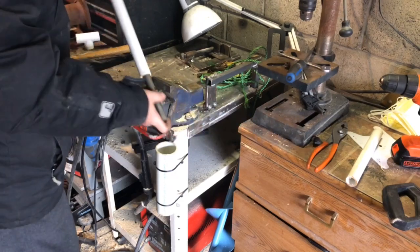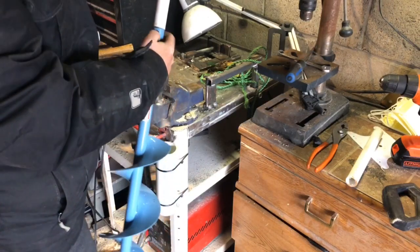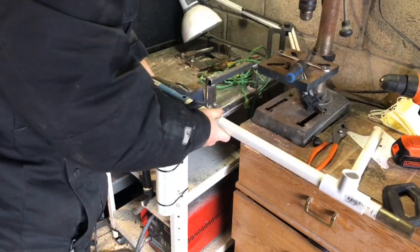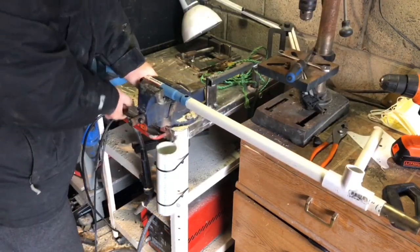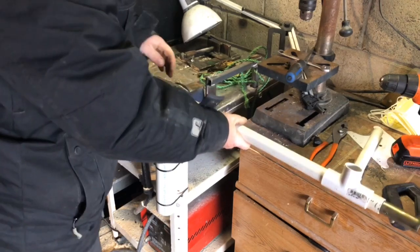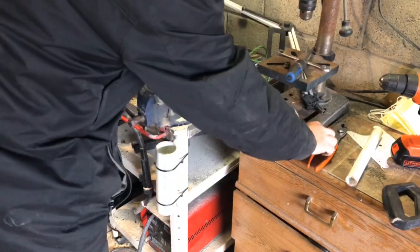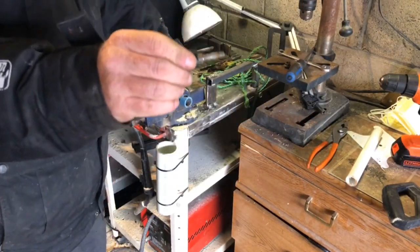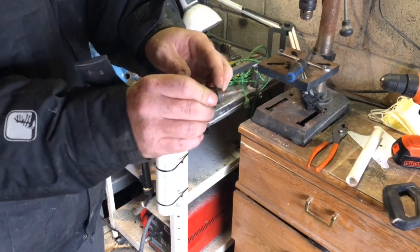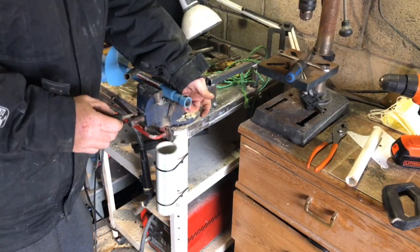So there, it'll go into the auger. Then drill a hole. I want to make it easier for you — put the auger in the vise. There's a big hole and then there's a small hole, like on the bolt, there's like a little sleeve. Just drill in one side so you don't hit the threads and have to re-thread it.